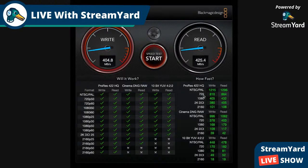On the right you can pretty much do anything as far as writing to this disk. Say you had a Blackmagic camera or a Z Cam and you wanted to go straight to hard disk — this would be a perfect solution. Cinema DNG raw goes up to 4K 30fps for both read and write. ProRes 422 HQ can do 4K 60, and 10-bit YUV 4:2:2 can do 2K DCI at 25 frames per second.